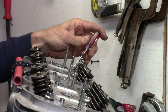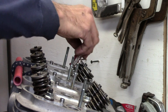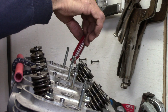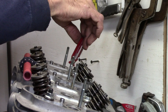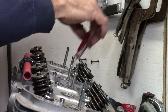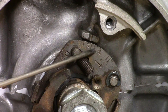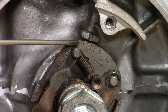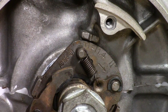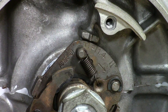So I need to come up on number one cylinder top dead center. Take a long screwdriver and poke it down into the spark plug hole. If you hold that up and slowly rotate the engine, you'll see it coming up — that's top dead center. If you go past that, the screwdriver starts to go back down. So that should be just a little before top dead center. Now over here on the spark advance unit, see how it says T, F, and then it says 1, 4 — that's cylinders number 1 and 4. The first mark is the timing mark, F stands for where it fires. We're going to put that right where it says T and line it up with that little notch. That's exactly where we want to be when we set the cam.